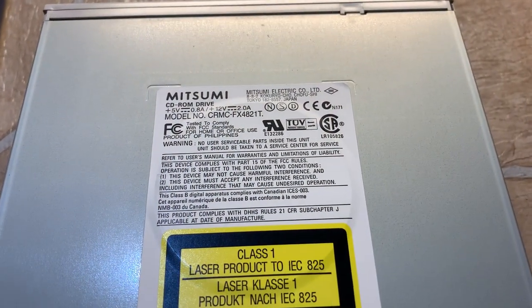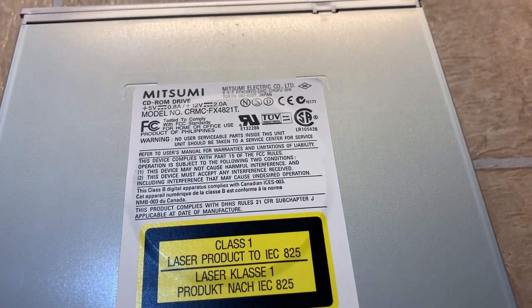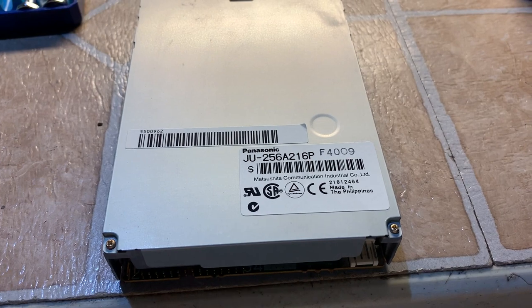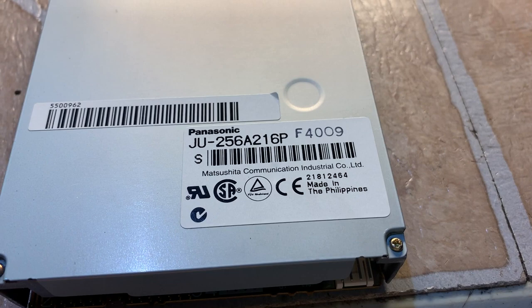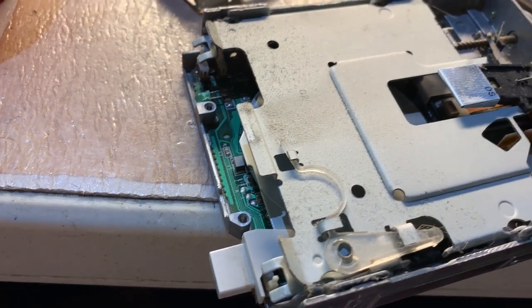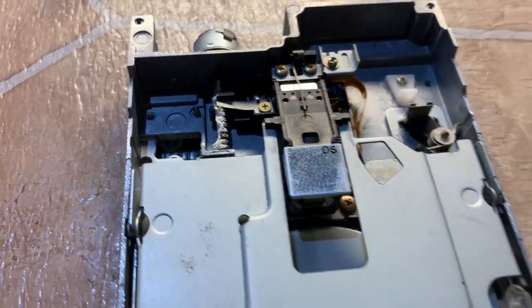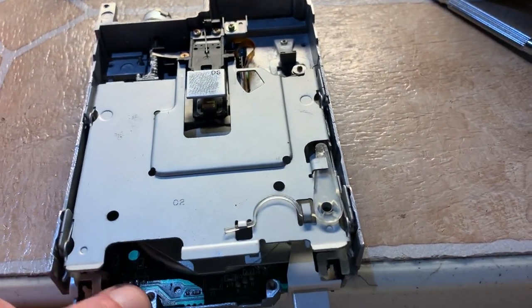This drive was a 300 or 330 dollar option: 8x CD-R, 4x CD-RW, 32x read speed. Inside the Mitsumi 48x CD-ROM — the laser lens isn't as hazed over as the one in the writer, but there's some crud on it. We'll clean that and lubricate the sled. And last but not least, the three-and-a-half inch floppy drive — Panasonic, made in the Philippines, not made in China. Cleaned both heads and lubricated the worm gear.